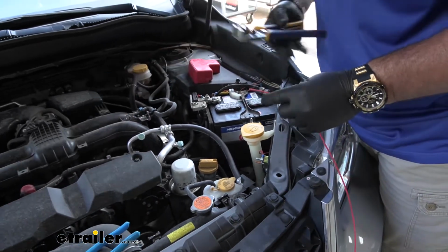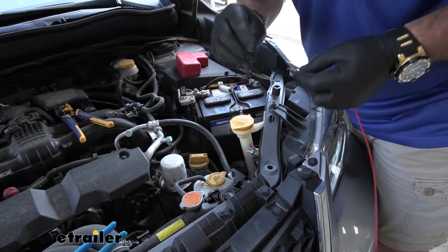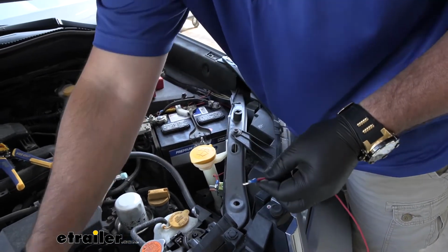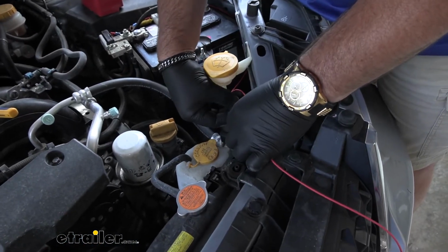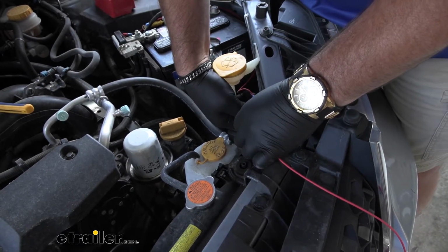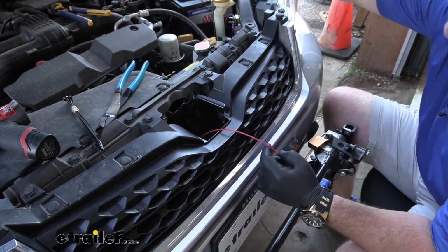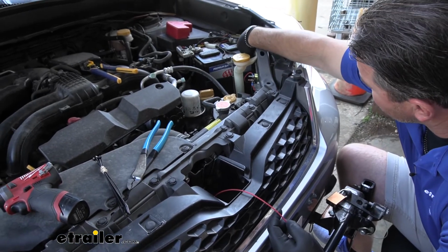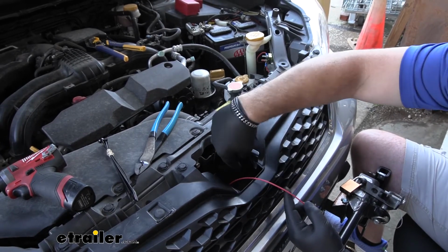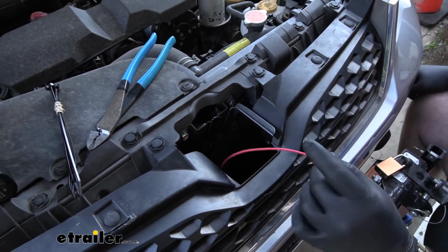Now we're going to strip back one end of our remaining wire. We're going to add on the other small ring terminal. Add it onto the copper post. Then we need to route this down behind the fascia. I routed the red wire by following the wires from the braking system and the diode kit straight down behind the fascia. If you look straight down here, you can see where all the wires are running. I just used those wires to run my red one.